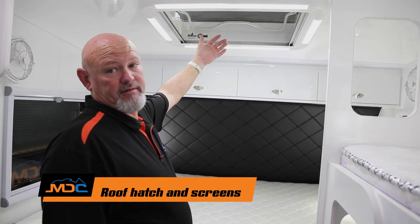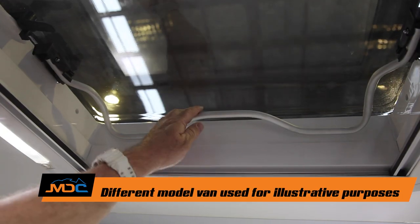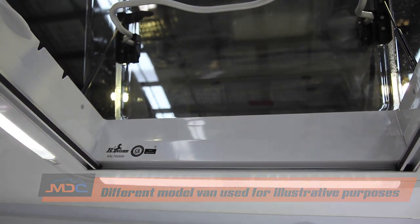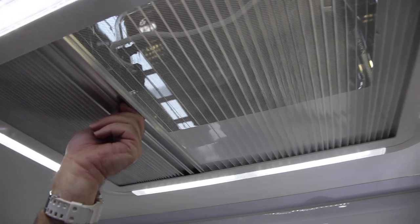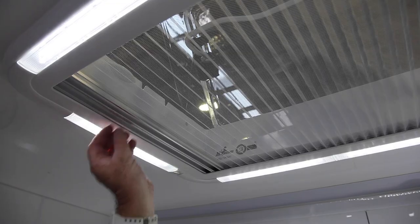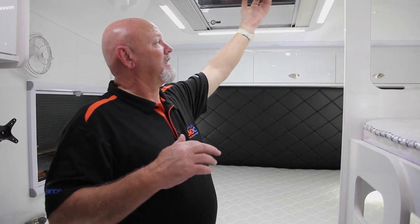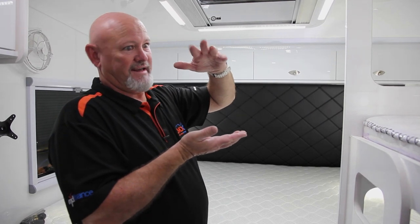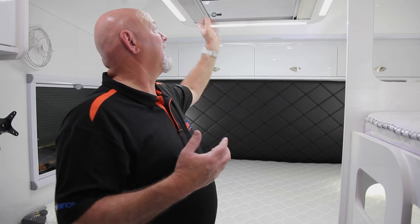Above your main sleeping area, you have a hatch in your roof. It's got the same tabs as the windows — you still got a button, you've still got to push it on both sides. You've got a handle that swings down and then you can open it up and push it up. There's only one setting — it's either opened or closed on this one. You have got privacy and also fly screen — you can do a 50-50 if you like. But what I will warn you against is when it's closed up and you're not using it and you have your blind across — what it does is it builds up a lot of heat, a lot of hot air in between the two surfaces. So what I will tell you to do is not have that closed up; let the air come through so it circulates a little bit more. On a 40-degree day, in between those two areas it can go up to 70-75 degrees. So just make sure that's open so it filtrates through and you don't get any warping of these two units.